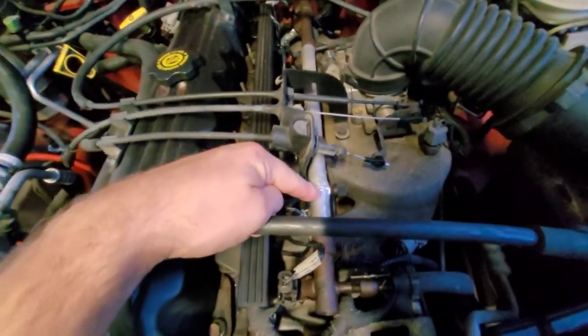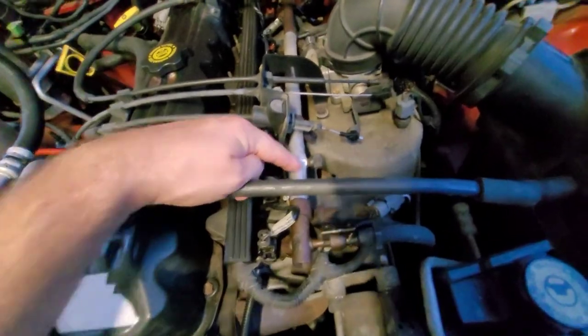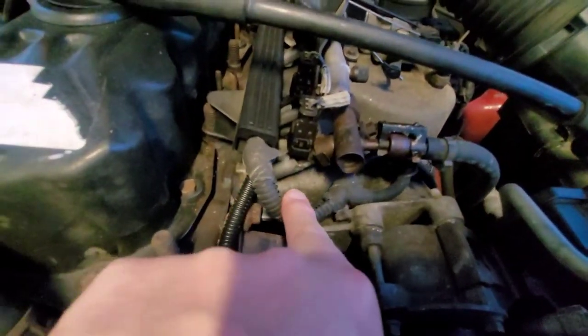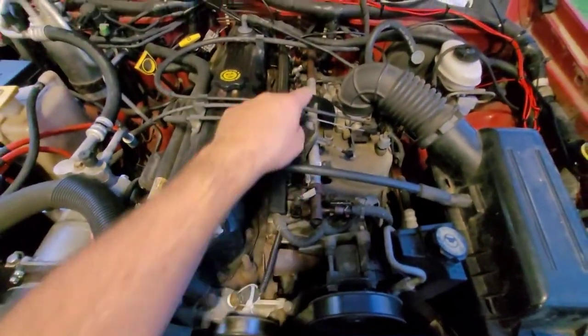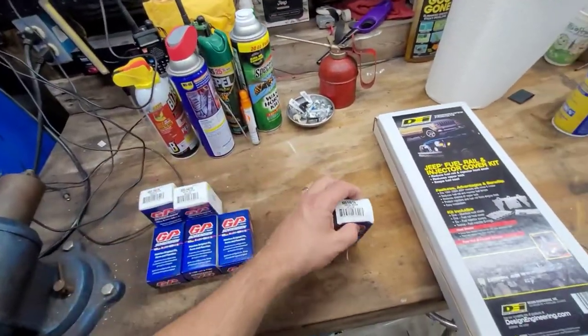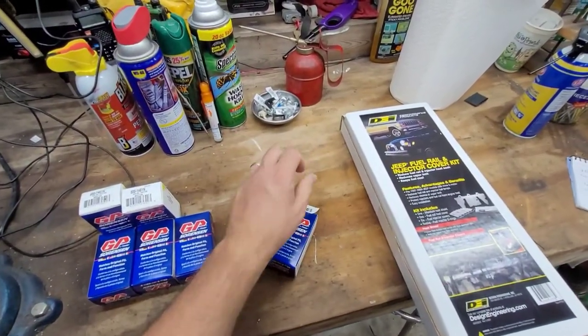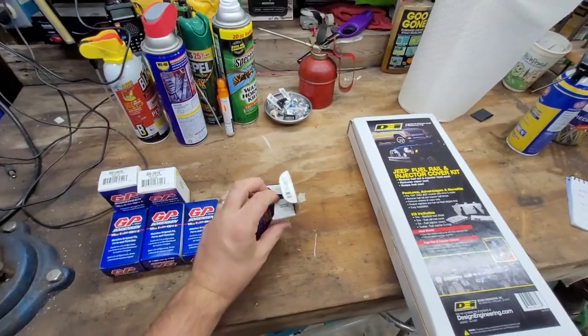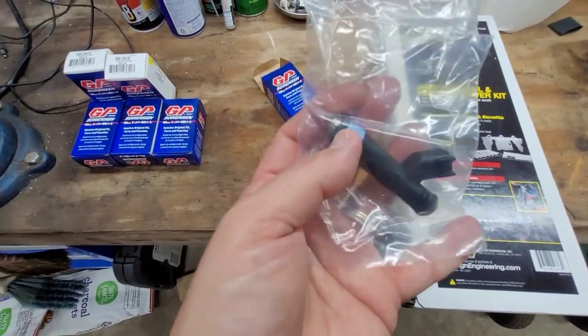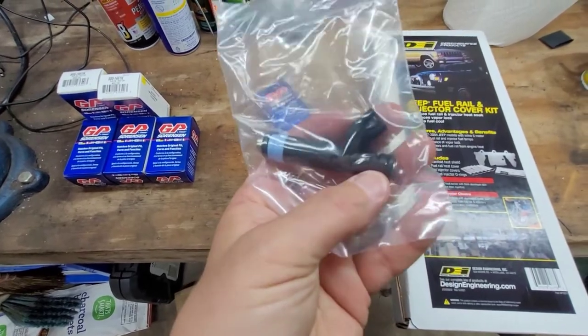On this system, somebody did a pretty poor attempt to cover this fuel rail - it doesn't go all the way down with this heat reflective material, and there's a little bit on these old fuel injectors. When you buy a fuel injector, it normally comes with a replacement injector and o-rings. On this fuel injector you can see it has an o-ring here and an o-ring here.